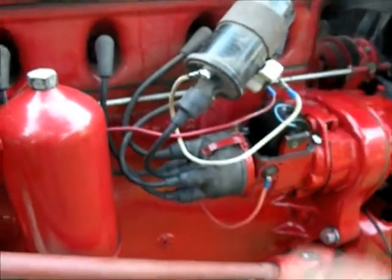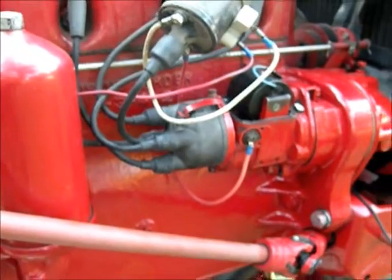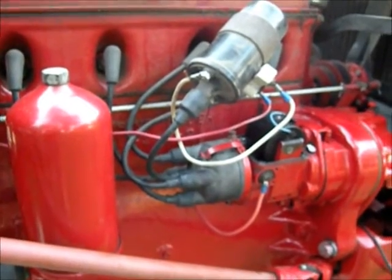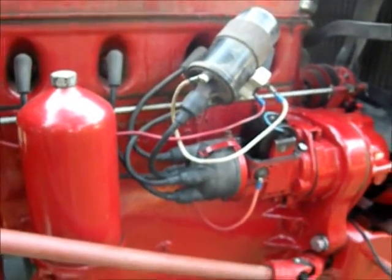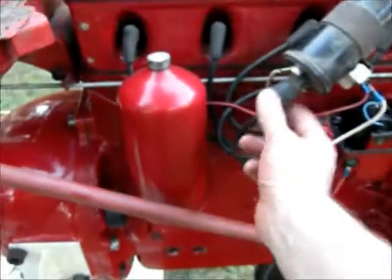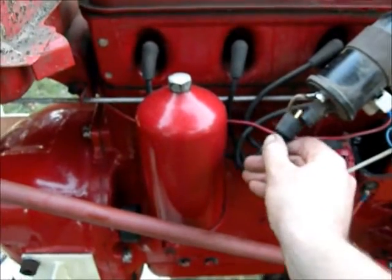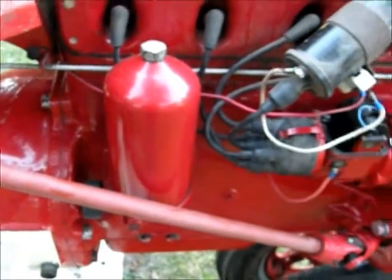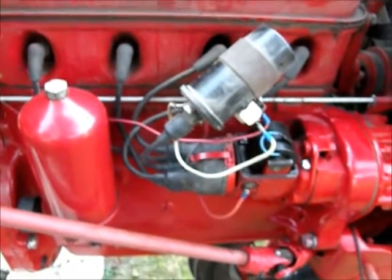Just a little bit of extra work with the resistor, but otherwise that's the way it is for mine. I kind of saw the same setup on one that someone had at a tractor show, and I just looked at it and thought, oh hey, I can do that. Rather than the wire that would have normally went on the magneto cap, you just take it and plug it into your coil — the center wire off of the distributor cap. Next I'll show a shot of it starting up.